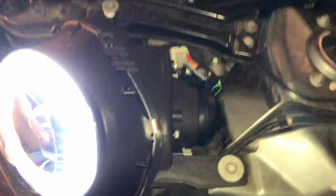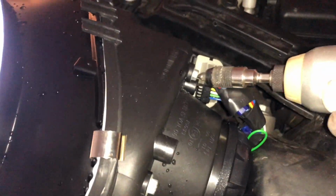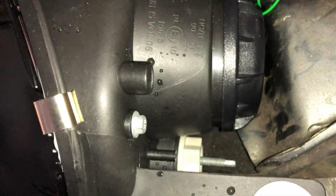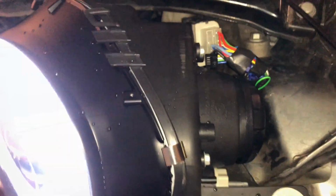This is already after probably 10 minutes of kind of messing with it to get it to this point. I'll include some clips of what it looked like before. The way you adjust these headlights is by these two screws in the back. So I just use a drill and kind of screw them in. There's also a height adjustment all the way in there. I just made sure they're exactly the same before I put the headlights in, just because it's very difficult to get in. I will need to raise it up just a couple inches, so maybe half a turn on here. I think I'll be able to manage that just by putting my fingers in there. It's pretty tight, but that should work.